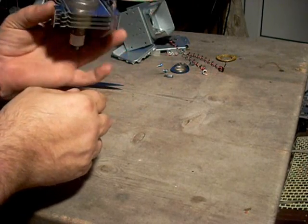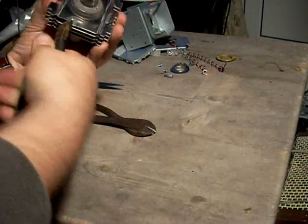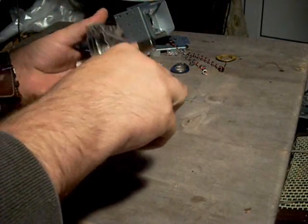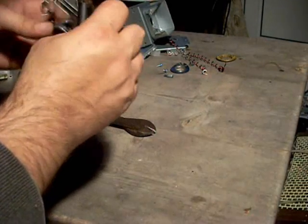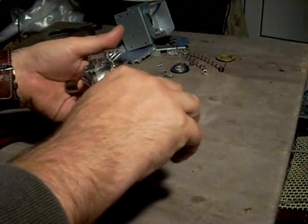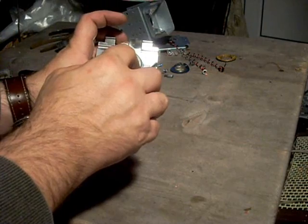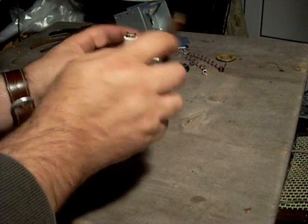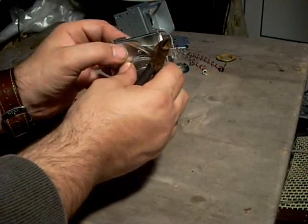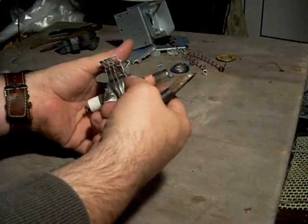Now these are aluminium — or aluminum if you're American. They're purely cooling vanes. These should be able to peel off of the magnetron without any damage. Basically, the low voltage goes in here for the filament, across these two. The high voltage is applied between those two filament terminals and this, which is frame ground — which is actually earth ground as well, to the microwave. And the high energy microwaves come out of here.